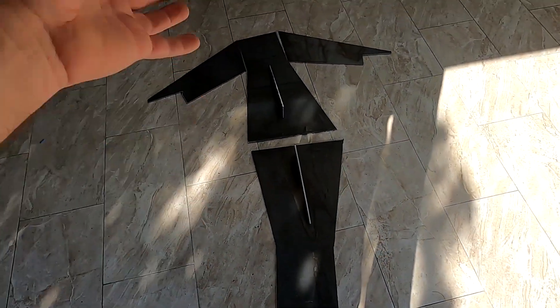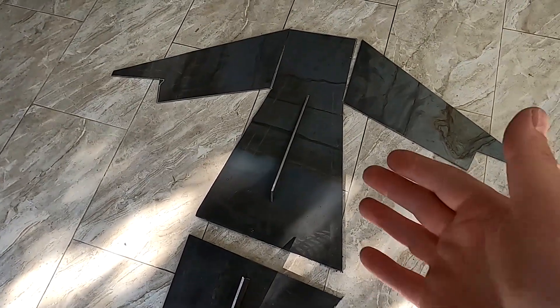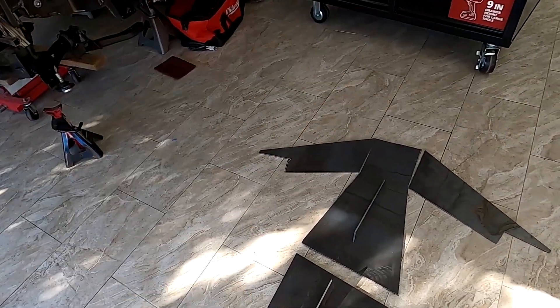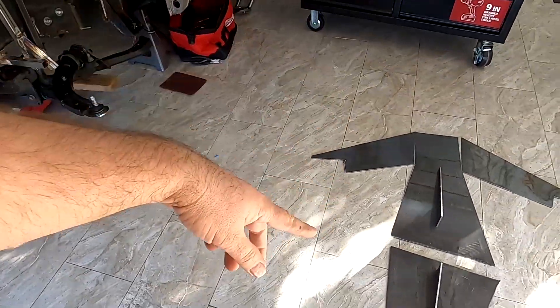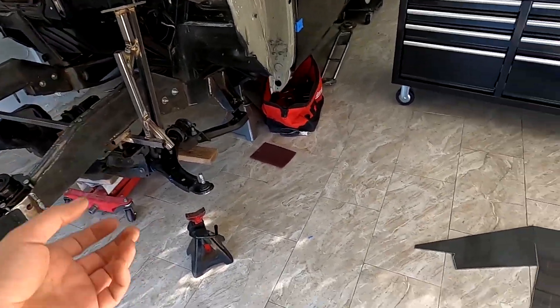I cut out the driver's side — the left side — and the center piece for the right side, but I ran out of metal and have to get more. Here is how this piece is going to be. I wish I had a big brake so I could keep it all in one piece and just fold it down — that would have been the strongest — but welding it will still look good. Next I'm going to be fitting it on the car and grinding these pieces to make sure they fit the concave shape.